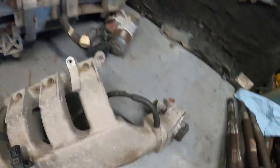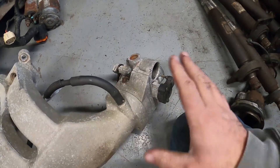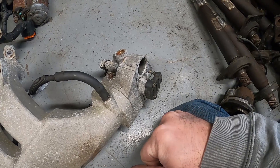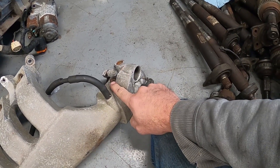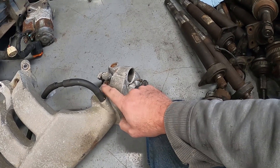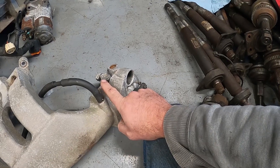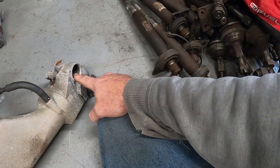This spacer here is missing this vacuum port because it was sitting out and actually rusted off. That port hooks into your EVAP system and back to the turbo and some of your vacuum lines. You can look at your diagram that's on your hood or find it online.